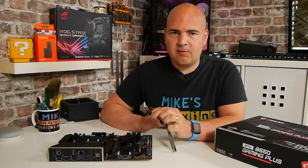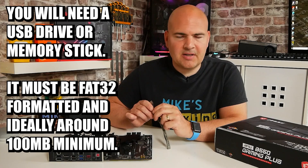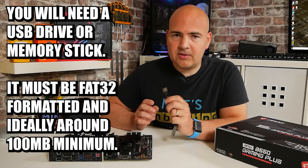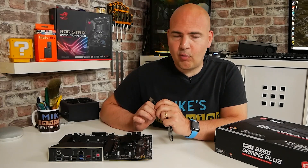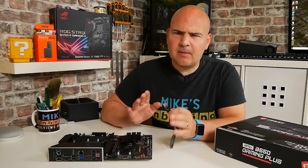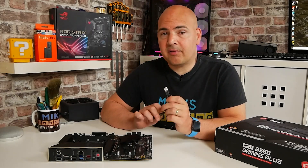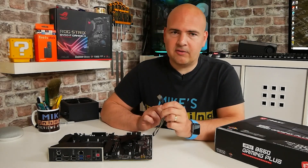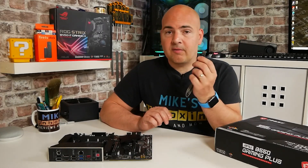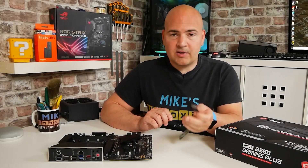First of all, ideally you want a USB stick, preferably around about 8GB in size — actually smaller is better. A slightly older USB 2.0 device is preferable if at all possible, but you can use any device up to about 128GB. They do have to be formatted in the FAT32 format, so do take that into consideration. You may also need to format the USB stick, so if there's any information on it, maybe buy a new one or transfer the information elsewhere.